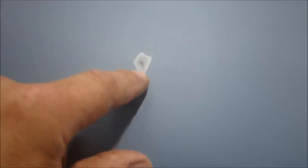Coming over to the front of the hood, same thing here. And that's why you sand this down first. You sand it down first so you can try and find all the low spots and all the chips. Going through the front here, there are chips all through the front of this. Down here, lots of them on this side. Lots of little chips. Come up on top of the hood. There's an area here that was really high, and I'll have to investigate that to make sure that's not a rust spot coming through.